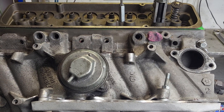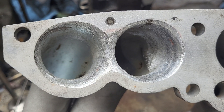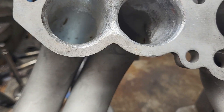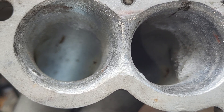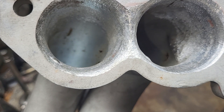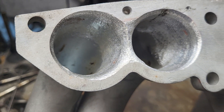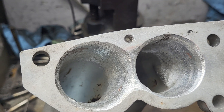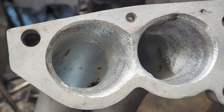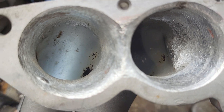As it sits now, this all flows quite a bit better than any of the 083 stuff I did on the Speed Talk thread. When I say mildly modified, I mean I put a little bit of a radius around it — you can still see there's a big bump I left, I must have missed it. But that's how it was tested. I couldn't even put clay on it; there's no meat that'll hold the clay, it just got sucked right in.